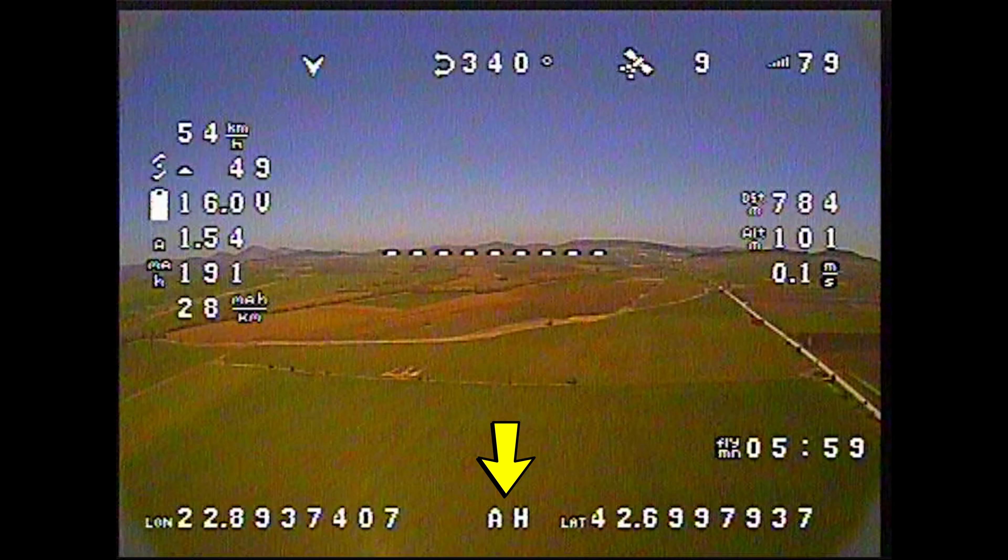Going up to 450 meters only reinforced that feeling. Whereas with the strakes it felt as if it was on rails and there was barely any rocking at all, now the rocking was very noticeable most of the time and with a much larger amplitude. That for me was the first noticeable evidence that these strakes actually do make a difference — you just have to keep the speed up.